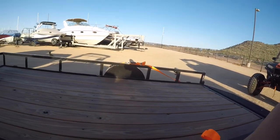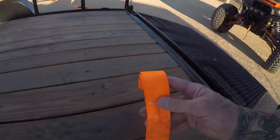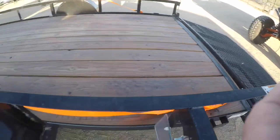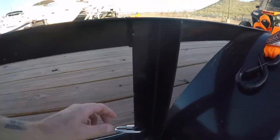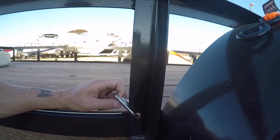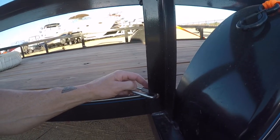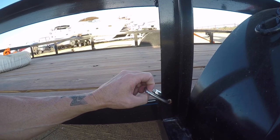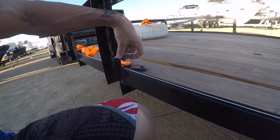Back to the ratchet straps themselves — these are heavy duty ratchet straps and we use a loop on these. We'll demonstrate what the loop is for. That loop is actually to keep from scratching our paint or powder coat on where we tie up to the vehicle. A lot of trailers like this one do not come with an actual tie down weld loop. So what we've done is we've drilled a half-inch hole and put a three-eighths inch locking carabiner, or removable link, in there. We'll show you how we're going to tie this up.